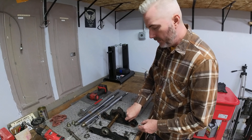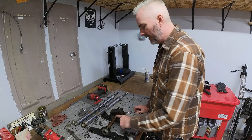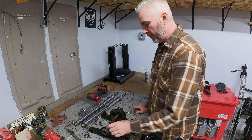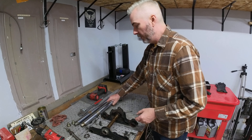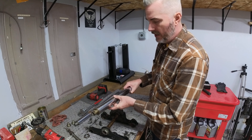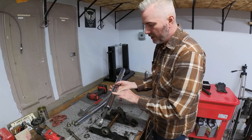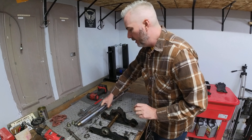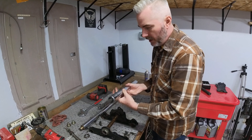I want to go ahead and clean everything up here. I know I need to get new neck bearings — not that these are in real bad shape, I just want to replace them since I'm in there anyway. These are probably good enough, but since I've got this thing torn down this far, I might as well go all the way. From here, with the tubes, there's a little bit of rust and galling on them, so I'd like to clean these up. There's a little wear here and that may be a leak point, so I might end up replacing these as well — that could be why these are not sealing well. This one's in better shape by a lot.